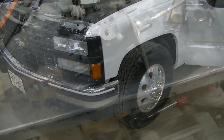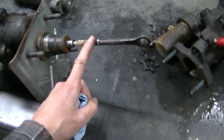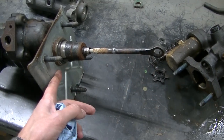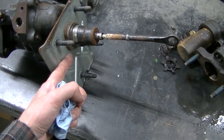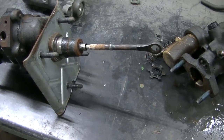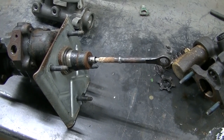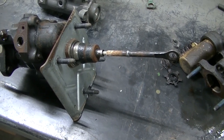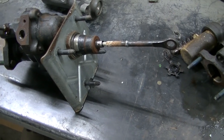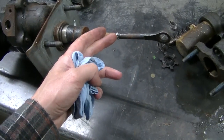Here's the hydro boost I used and here's my welded rod. I was trying to go with about eight inches total length but it ended up longer than that. I'm going to try seven and a half inches from the backing plate to the end — maybe a tad shorter. I think the rod being too long was messing up my pedal and could have been the whole reason I'm having trouble. I'll put the hydro boost in first, and if I'm still having trouble with the front brakes, I'll go with the new master cylinder too.